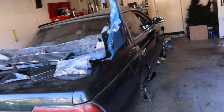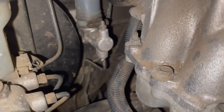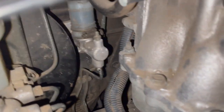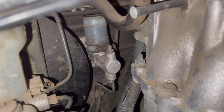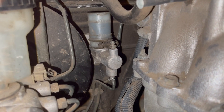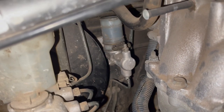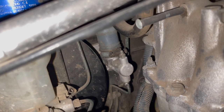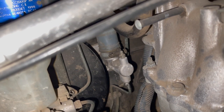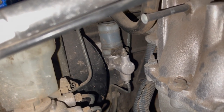Time to work on this one. So for the last couple of hours, I've been trying to remove the clutch line off of the master cylinder to replace the cylinder, but it slid on me, so I don't have any more grip, even though I've used a proper flare wrench. So I'm just gonna order new fittings and a new AN line, and that'll be easier than messing with that or trying to fix it. So yep, I guess I'll see you in the next video.